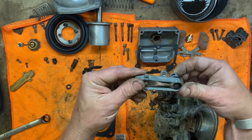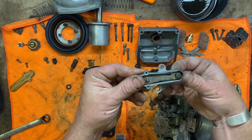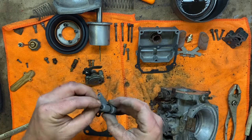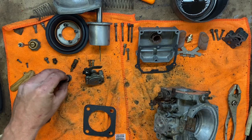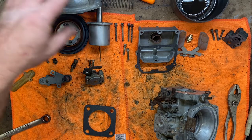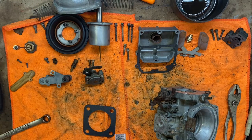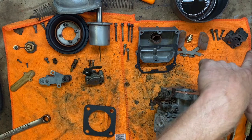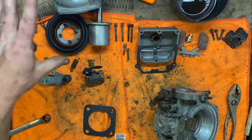So I get that. This is the compensating valve, which I take it is the power valve by them. It does not have anything new, but I did ungunk it, so it does move freely on its own with that spring. It does have two gaskets that also had gone missing in the ages that it had sat. Everything else is cleaned up. We're pretty good to go. So I guess we're just gonna start reassembly from here, working this way, then here, back to the beginning.